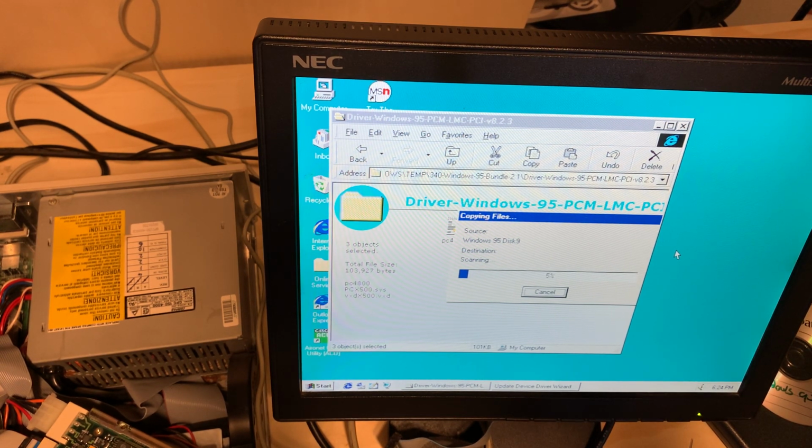While we're waiting, I'm going to plug in my router that I have set in WEP security. Little disclaimer, yet again, is that these videos do not necessarily go according to best practice. It is simply, does it work? And why I'm doing WEP security is because that's all this card can do. It's the highest it can go for security-wise. This is 2021, so if you can get away with running WPA3 security, that would be great, otherwise WPA2 is what you should be doing.